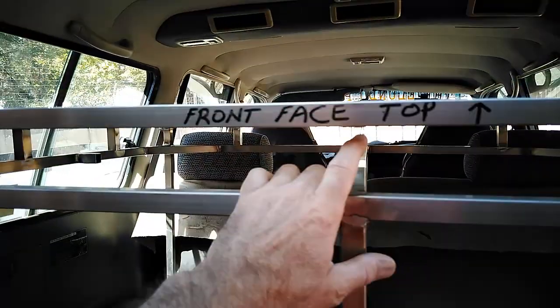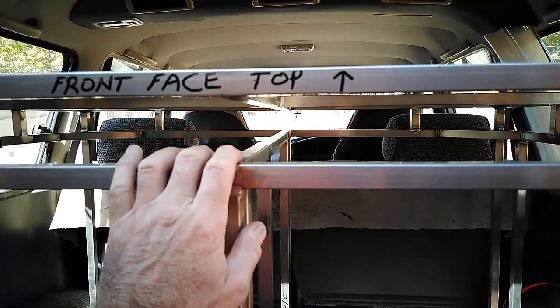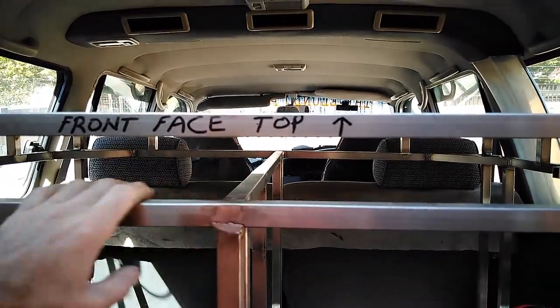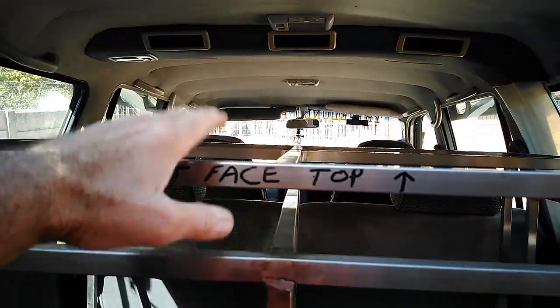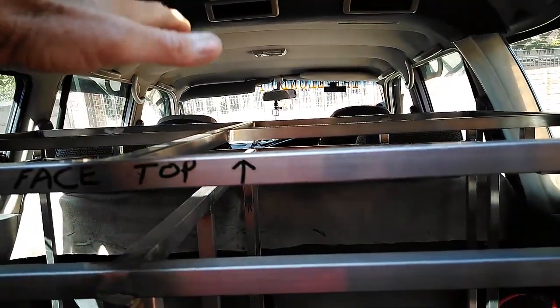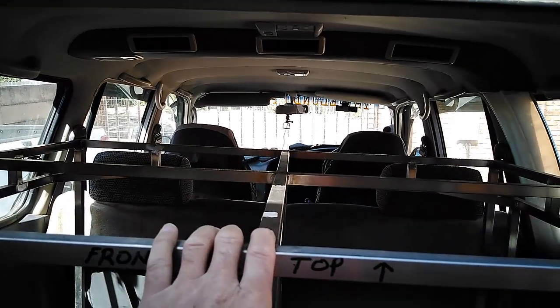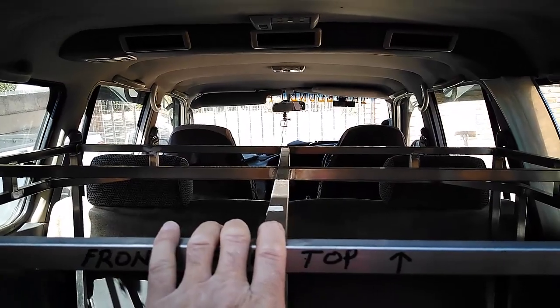The tables will be resting basically on these corner pieces and the tabs, as well as the center section over here. So I've elected for, I might even go 3 mil ply just to close the gap. That will be also carpeted, obviously, to minimize noise and scratching and that kind of thing. The top sides are going to be getting a 6 mil ply, because obviously I can load things onto here. I've made a cross going across the width and the depth of the drawer system, and that will support the plywood.